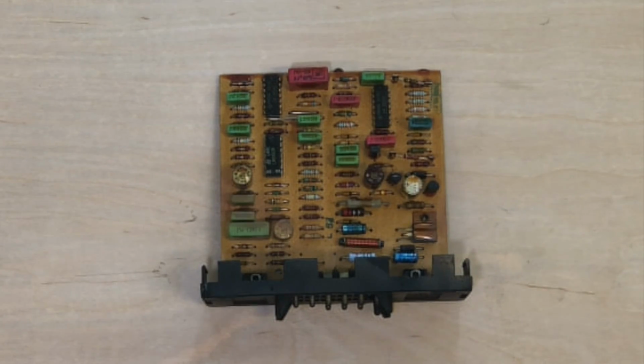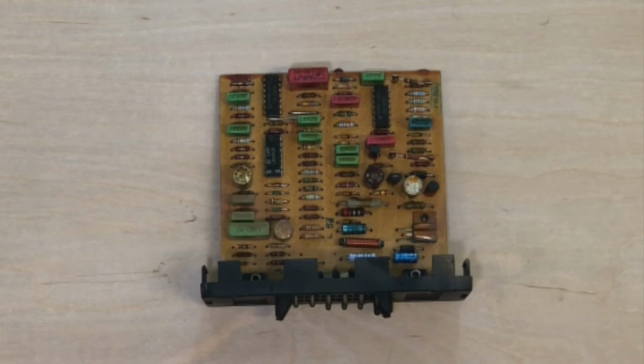Anyway, the first thing you should know about the idle control units is that the 380 and 500 had different idle control units, and these part numbers also changed if they were European market cars or US cars. You can't replace one with another and get the exact same perfect result, and there were also different versions of the idle control valve. So the unit that we're using is one from a US 380 SE, but they all look visually the same.